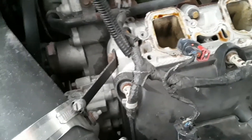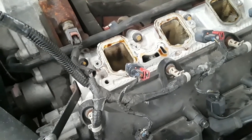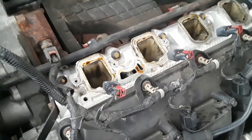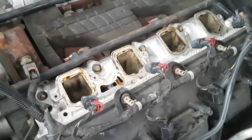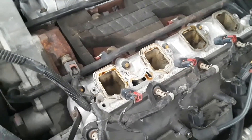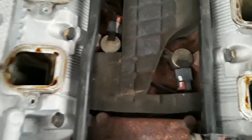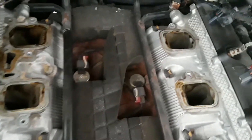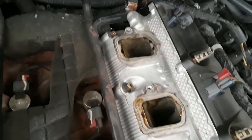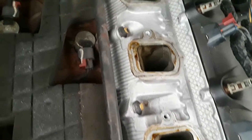This procedure for removing the intake manifold on a Dodge Charger RT pretty much goes for the Chrysler 300 from 2005 all the way to 2019, because they're practically the same engine. The only difference is mine has the EGR valve on the intake manifold, so it's nothing major. I keep my heads pretty clean as is, so there won't be much to do. I'm probably going to port and polish my heads again — that's pretty much the only modification I've done to the heads so far.